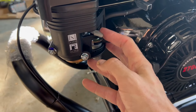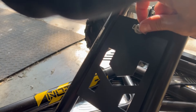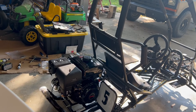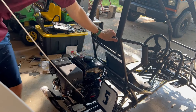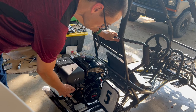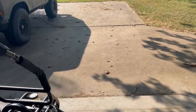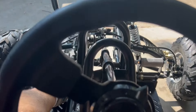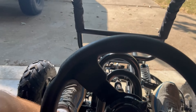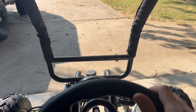The top gray lever is your choke, and the bottom one is your gas. There's an on and off for your fuel flow. You just want to pull the choke back towards you so the choke is engaged. This is really critical and something that took me a while to figure out: make sure the kill switch is set to off and that the switch on the rear of the motor is set to on. Just after a couple of starts, got it running. Moving the choke lever back forward so it matches where the fuel lever is, then I just let it warm up for a minute and it's ready to go. I did have some rattling from the cover that goes over the chain — something I've since adjusted and it's not really been an issue. Just one of those small out-of-the-box things that takes some adjustment.